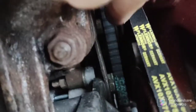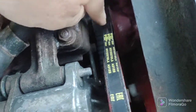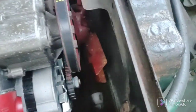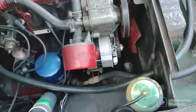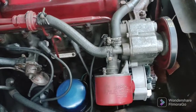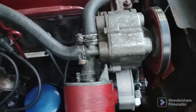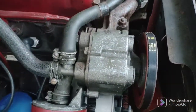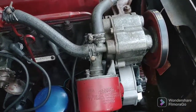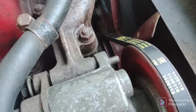There's your tension bolt down there in the slot — that's tight. Test your belt — that's good, it's not going to slip. This air pump doesn't have that much resistance. Now I'm putting the flat lock and the nut on the pivot bolt and tightening it. A lot of people take the air pump off — every horsepower counts when you're only pushing 90 horses or whatever — but I got this car with everything nice, neat, functioning, and original. The emissions stuff was still intact, so I'm going to leave the air pump on.